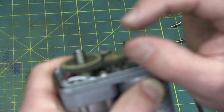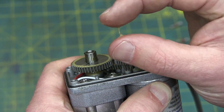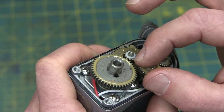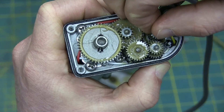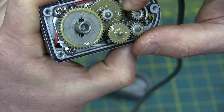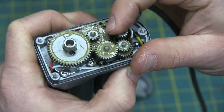We'll have a look at the grease. High sticktivity, opaque — probably calcium sulfonate, a nice high temperature grease. Nothing wrong with that. But I've been wrong before; could be bog standard lithium complex grease. Counting the gear teeth — probably 40 to 1, maybe 50 to 1. Close enough. It's roughly a 40 to 1 gear reduction.